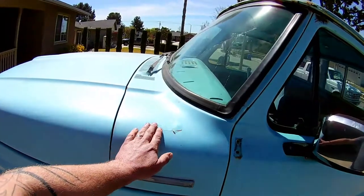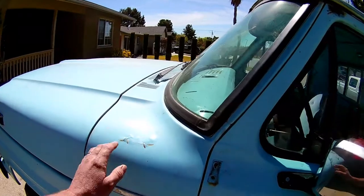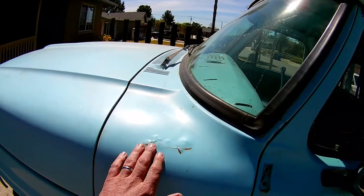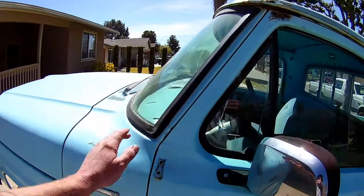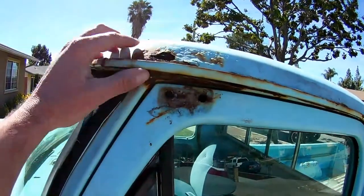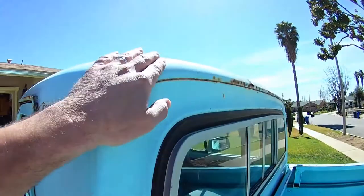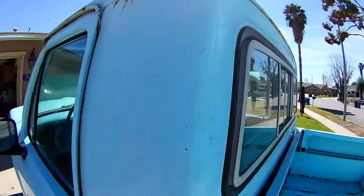You can see here there's some mystery bubbling underneath the baby blue paint. I'm hoping a lot of this is just bad body work — Bondo and some metal that needs holes filled. Up in the drip rails though, we've got some pretty serious rot that's going to have to be cut out and a new section welded in. Along the back as well, we've got some thin material to deal with.